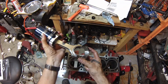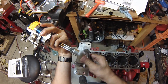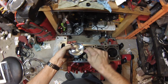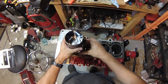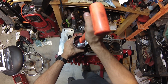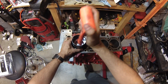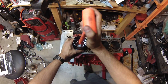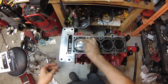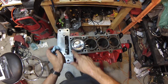Be sure to take off the connecting rod bottom cap. On this one there are numbers — you want to make sure that when you put it back on, you put it on in the correct orientation. Get it all nice and tight, then drop it down into the block here. Then tap it in using the bottom end of a hammer. There it goes. I'll leave it like that for now and come back afterwards to do them all up to the connecting rods to the crankshaft.